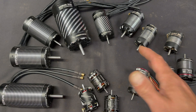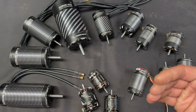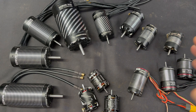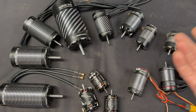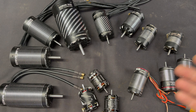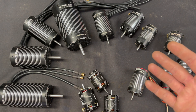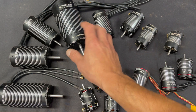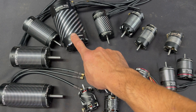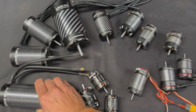Quickly, for the most part: for 2S you can go 4000 KV and above; for 3S you want to be lower than 4000 KV; for 4S you usually start somewhere around 1900 to 2200 KV. Some people run 1900-2200 KV on 6S and that seems to work. Once you get into 8S, 10S, and 12S you're down in the lower KV range — around 1100-1300 KV. For 12S you want as low a KV as possible. Our 7125, our only 12S-rated car motor, is a 560 KV motor. The 56113 is an 8S motor at 800 KV.